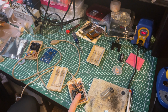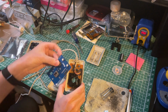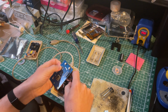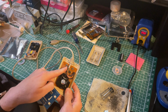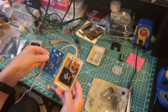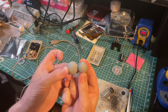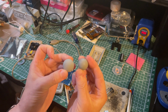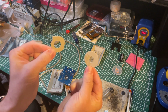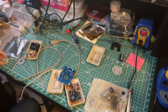So this is a model of the tank mouse that actually could have the board replaced. As you can see here, the cable ends are not soldered to the board. They can simply be unplugged and be put on here. We only have to desolder the ground wire, and all the holes line up nicely. Plus, a few other differences between those models. If you just compare the two models, you can clearly see a big size difference here, and different lids to keep the ball in place.